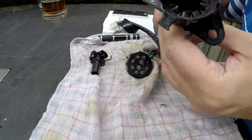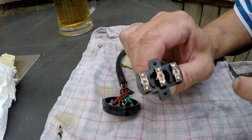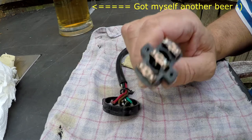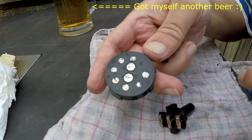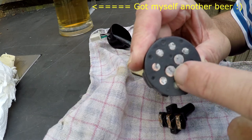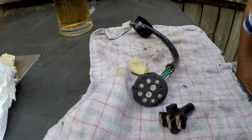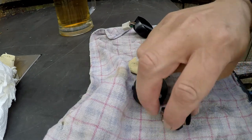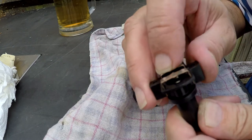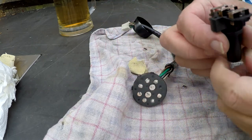It's raining so I'm going in. What I did was sandpaper these contacts, but I noticed some of them have been built up with solder — so this problem's obviously been there before. These all look like they've been soldered to rebuild the pads, but I've cleaned it up as best I can. I've also stretched these springs a bit because they weren't giving really enough force. So I'll put it back together.